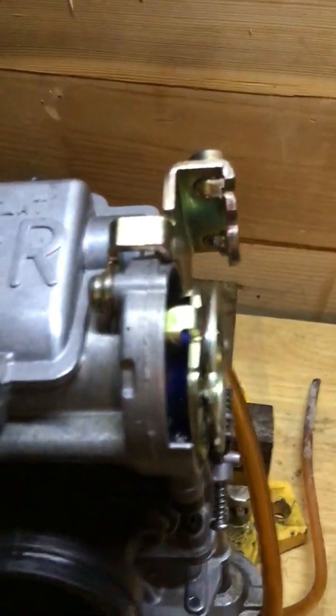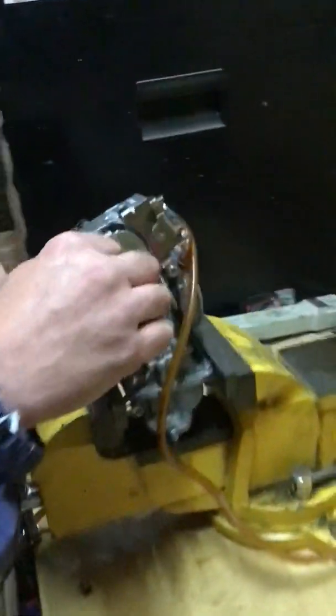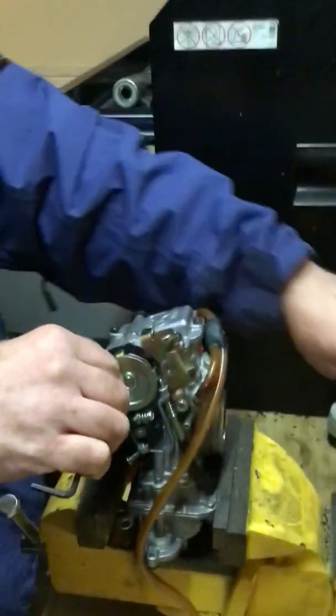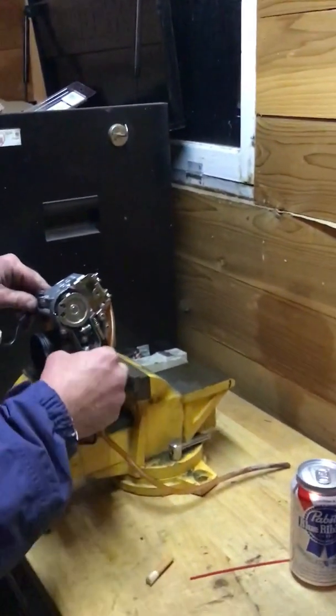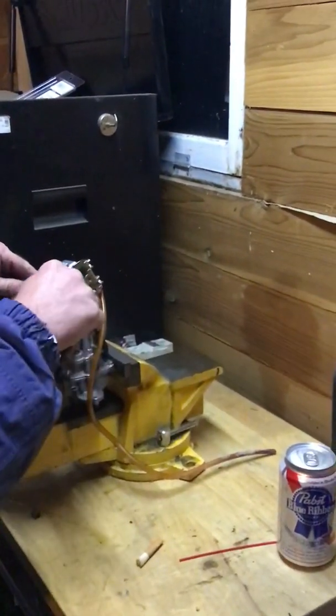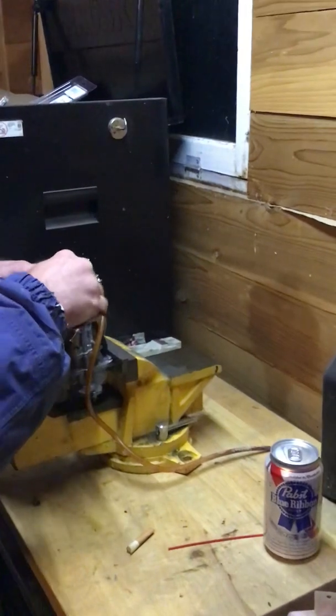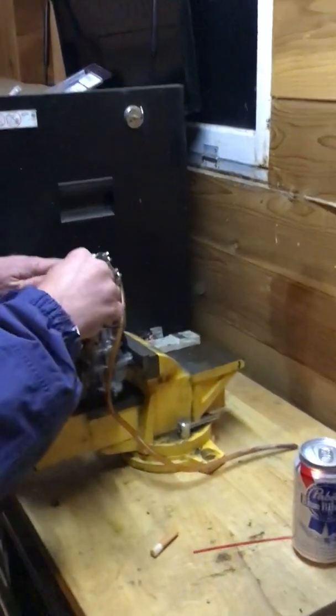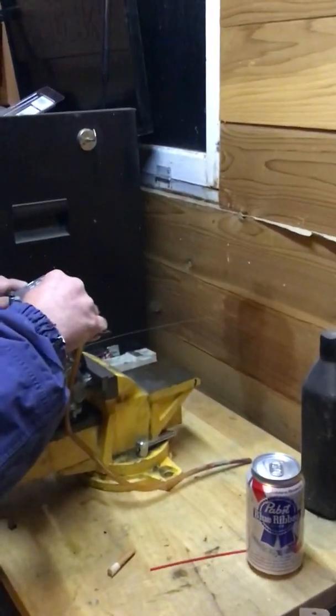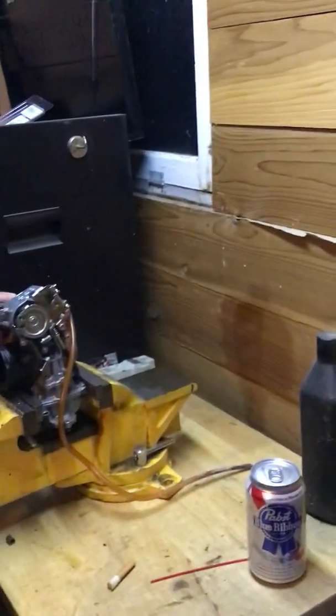And we'll go ahead and watch the, here, if you wouldn't mind holding that for me for a second. So what we'll do is we'll watch, this is stock, and pay attention to right here. Now keep in mind, this is what I was telling you about there not being a leak jet present in this float bowl and why this is important. Watch the duration of the squirt here. 1001, 1002, almost 3 seconds. Do it one more time. That is way too long.